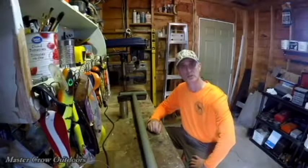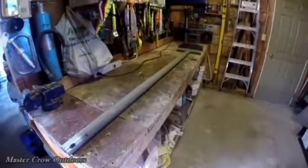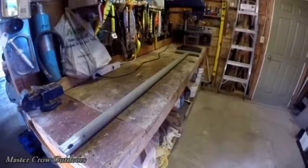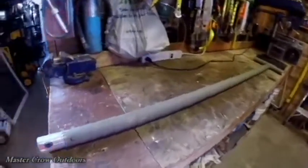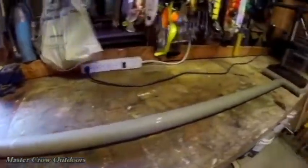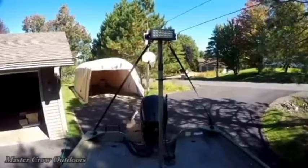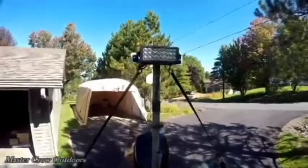Needless to say it's time for a new strategy, but that's going to involve some lighting, so here's what I came up with. In order to light up the whole boat I needed to mount the floodlight fairly high. Thankfully I had this five-foot T-post laying around from another DIY canopy project. It's an inch and three-quarters seat pedestal and I had an extension welded on up to the T where I'm going to mount the floodlight. I won't bore you with the construction details but this is what I came up with for around $100 and four hours of effort.